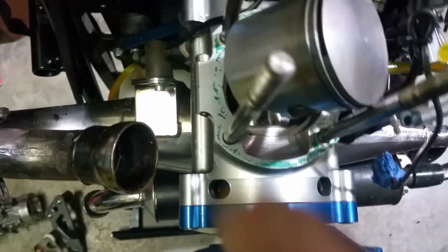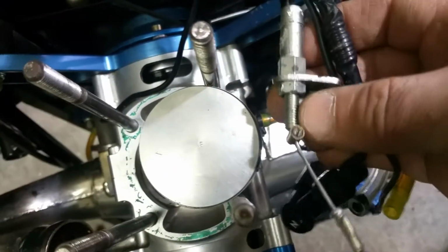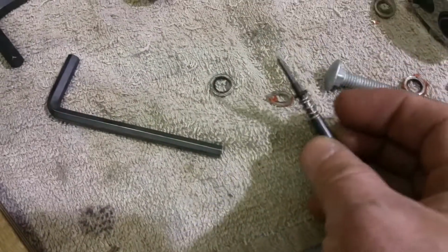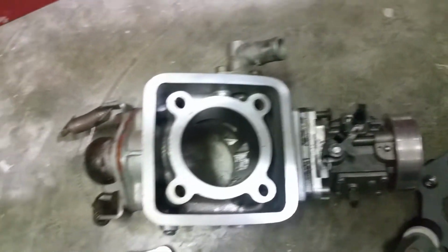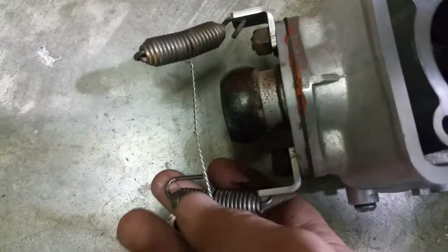It's actually the cylinder. So I took it out, and you may find that the throttle cable is in the way, and it's attached to the carburetor. So of course you have to look, and you may have to remove this adjusting screw on the carburetor, and remove the bracket that is holding the throttle cable. Then you take this one out, it's free, but I forgot to tell you that it also has 2 powerful springs that connect the whole engine to the exhaust pipe.